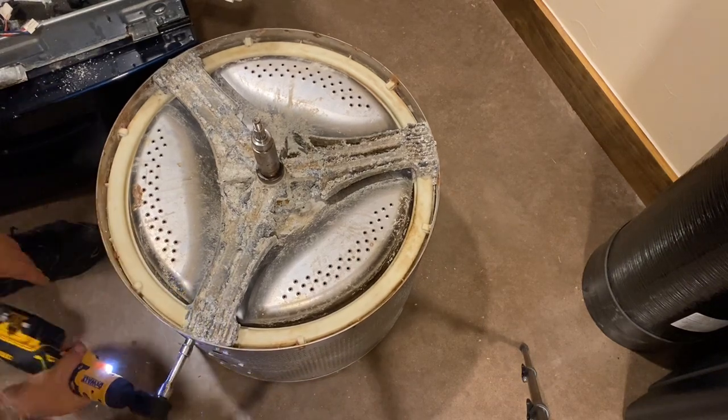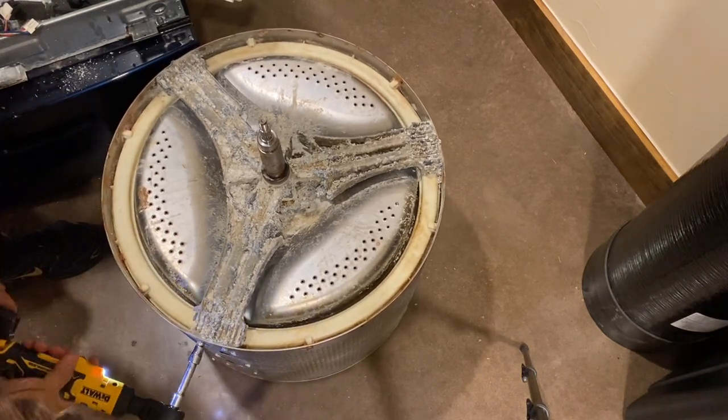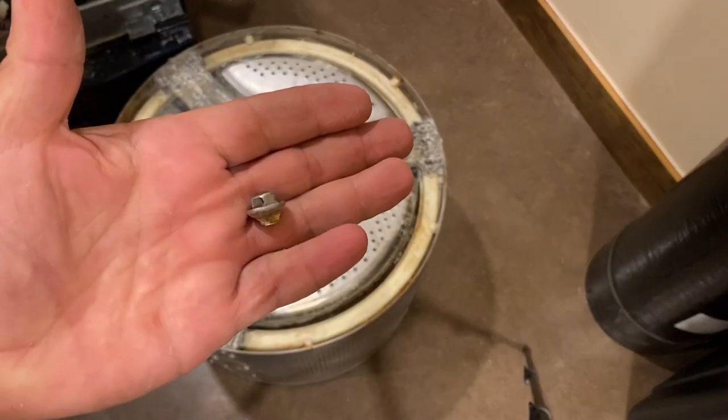You can see that this one started to just lose hunks of metal in here, but it was still holding together — so it was out of balance, but it probably wasn't totally unworkable. As these chunks of metal continue to go through the drain and get jammed, that's where you notice the problem. A lot of times you notice this needs to be fixed only because it won't drain, because that pump won't evacuate the water with chunks of metal stuck in it. What you're going to find is that some of these bolts don't survive — the heads will break right off. That's just fine; it'll still let you get the arm out.